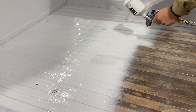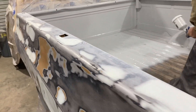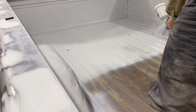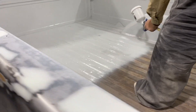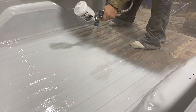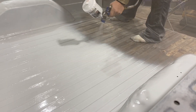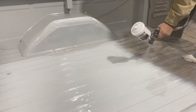I did lay it down pretty heavy on the base there so you can make sure any bleed-through or whatever is covered. It looked pretty good. We used about just a little less than a half a gallon of paint, and this primer runs a one-to-one mix. So a half gallon of paint ends up being an actual gallon of material because I'm using a half gallon of reducer as well. KJ did real good for me — while I was painting, he was in the background mixing up more paint to keep me going so we didn't have to mess around.